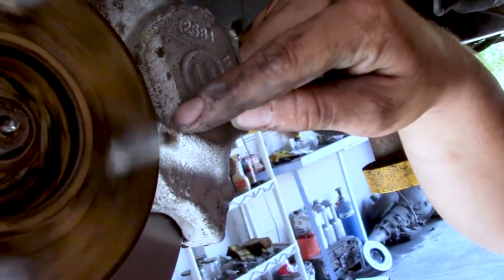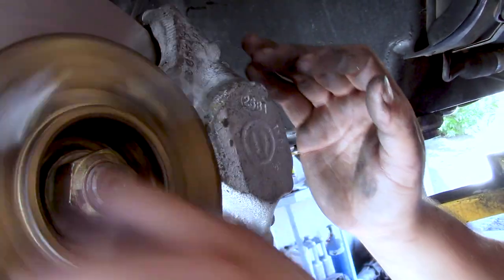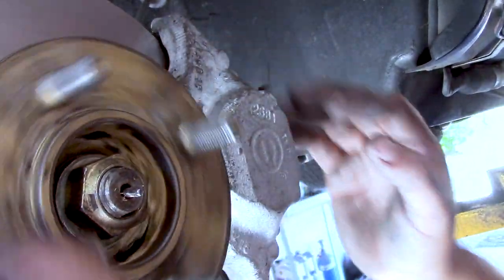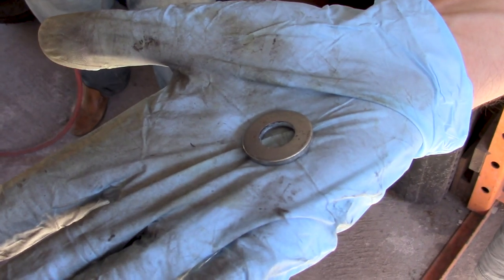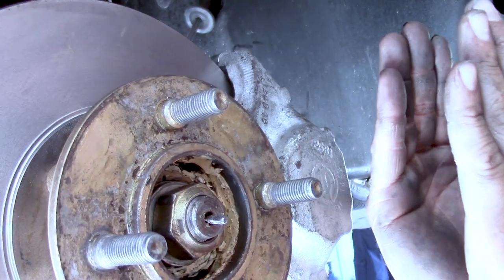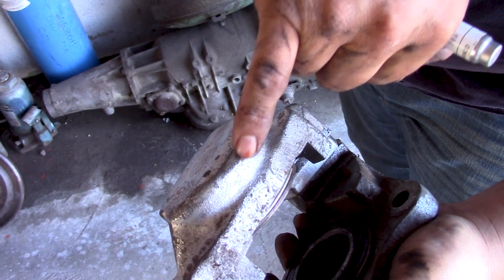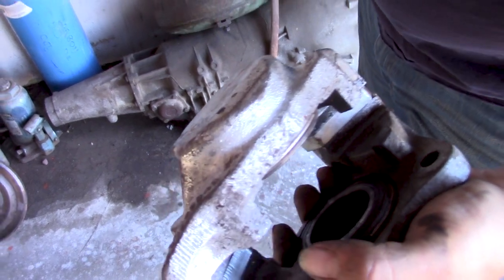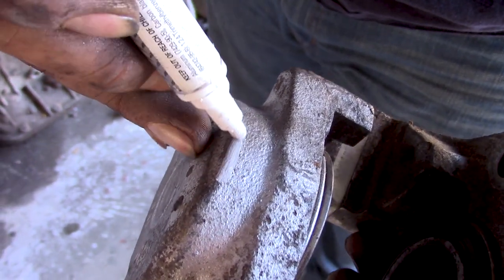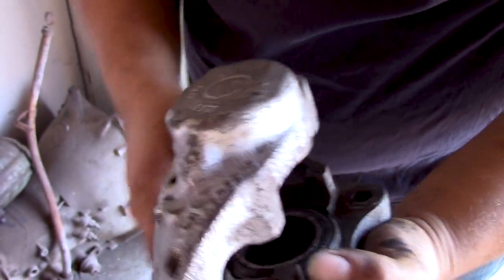It's barely rubbing, so what we're going to do is take down just the leading edge of this caliper, and that should give us enough space so it doesn't rub. You have to make sure that you put those washers on the caliper bolts, because if you don't, the caliper itself would sit more outward and the nubs on the other side would rub. Right where the paint is gone is right where the caliper was rubbing. So we're just going to grind that down a little bit and hopefully they won't rub.